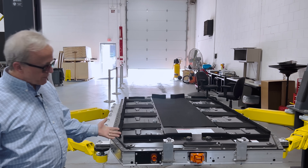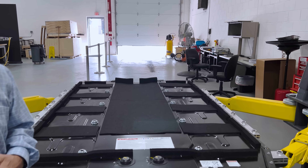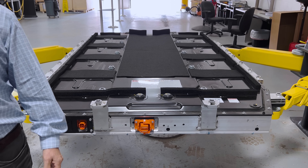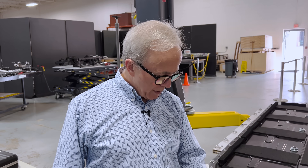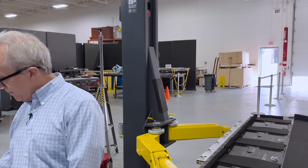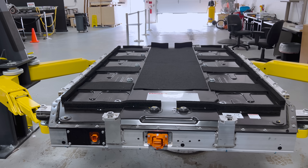The things to know about this battery pack: it's of the 800-volt architecture. If you watch this channel, you know that doesn't mean a whole lot — it gives you a talking point about its voltage operating range but doesn't tell you the actual operating range. In this case, it mainly means it's above 600 volts, specifically about 643 volts as a maximum down to about 462 as a minimum.